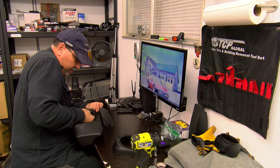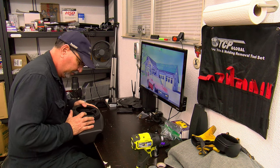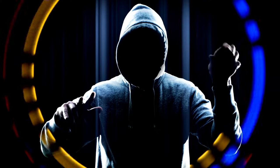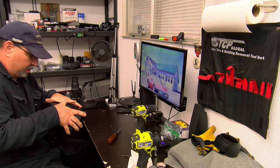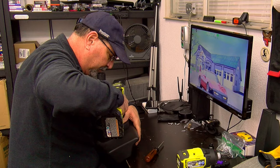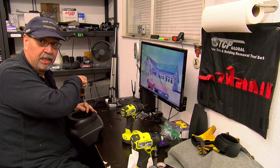Speaker adapter installation is a bit tedious — you really want to take your time because you have to drill into the glove box pod. I bought these adapters from an American company because I figured they'd have the correct mold to reproduce them accurately. With an idea of how these adapters will sit, I'll drill one hole, screw it down, then follow with the other two holes. I'm doing this by eye, which I wouldn't suggest — at least use a pencil to trace the outline before you drill to avoid regrets.